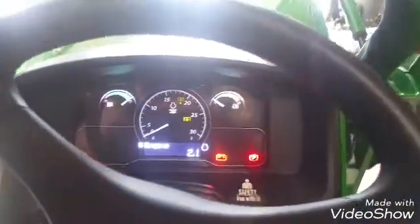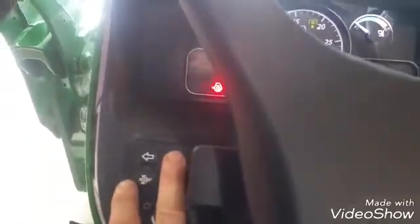To do this, step one: turn the key switch on but don't start. Next, with your right middle finger, press the display mode button — that's the button in the top middle with the little windshield wiper icon. Press that and hold it down.